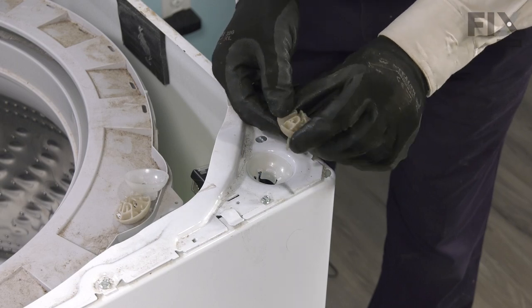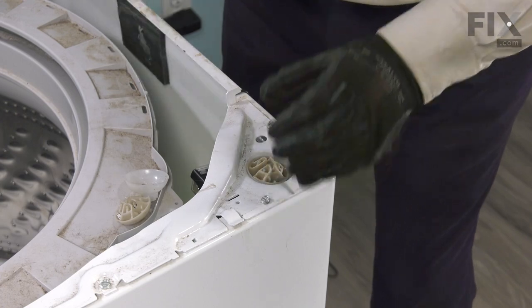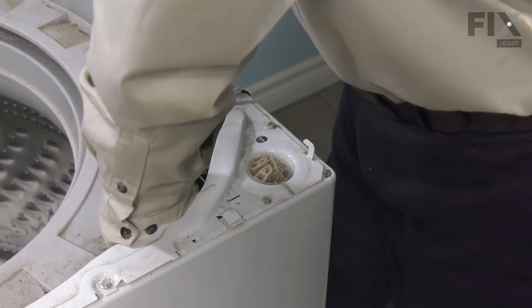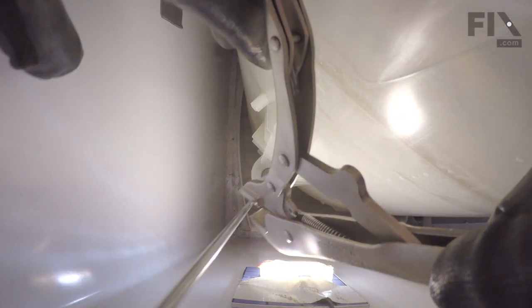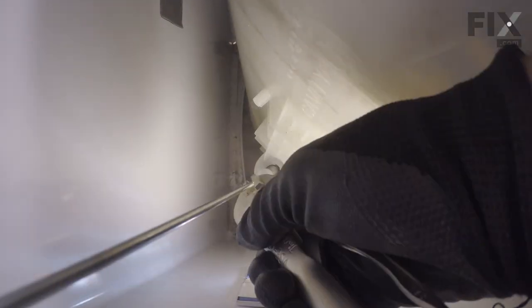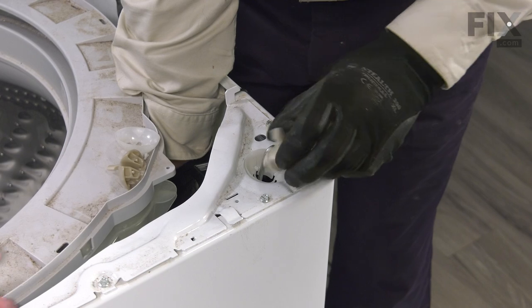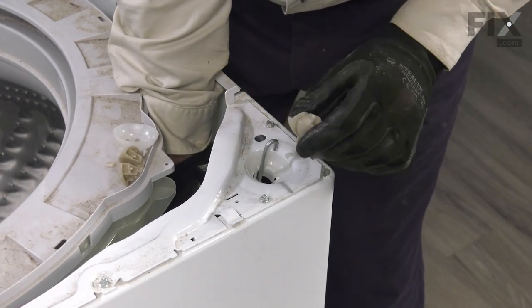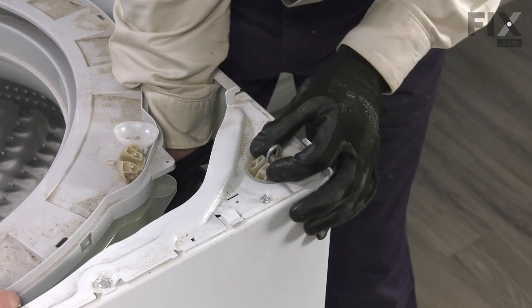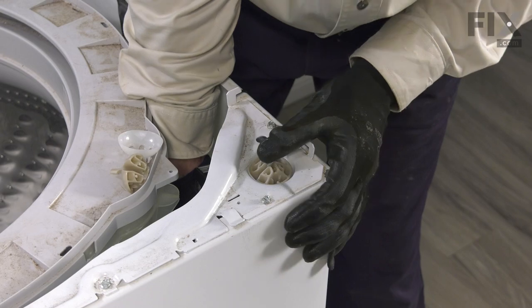We'll have that upper ball in position. We're going to grasp that rod — again, we'll use our locking pliers. Once we have a firm grip on that rod, we're going to pull it right up through that opening. We'll take our new suspension ball on the top, make sure that we engage that hook into an open slot on the back side, and let it drop down into place. You can then release your locking pliers.